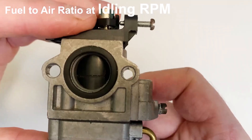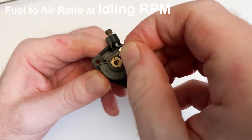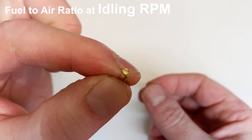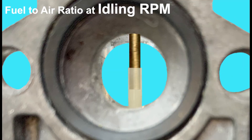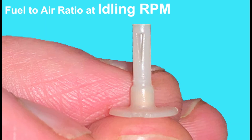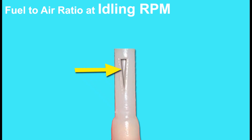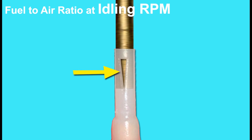So what just happened there? With these carburetors there is a needle that protrudes into the main jet, and it's the low screw that we've been adjusting at the top that is directly connected to this needle. When the needle screw is fitted in its correct place within the carburetor, it's sheathed within the protruding plastic part of the main jet. I've actually removed this part of the main jet so we can have a closer look, and what we see on the side of it is this cutout structure — an elongated triangle.